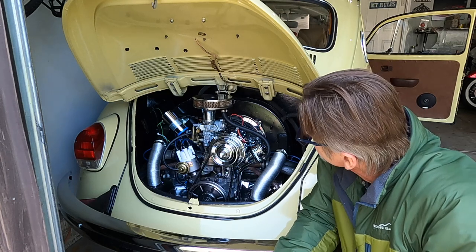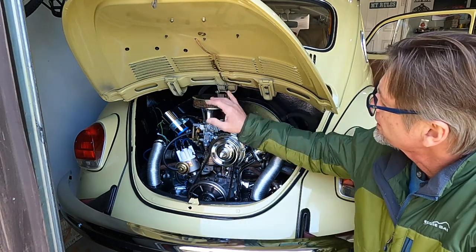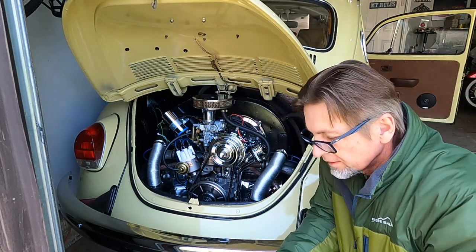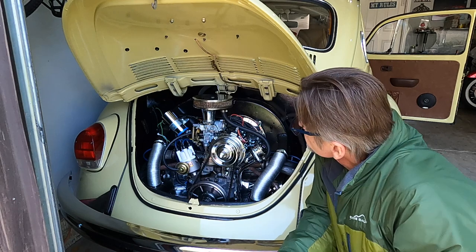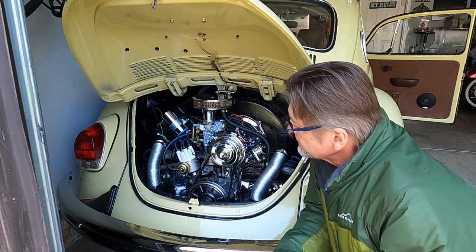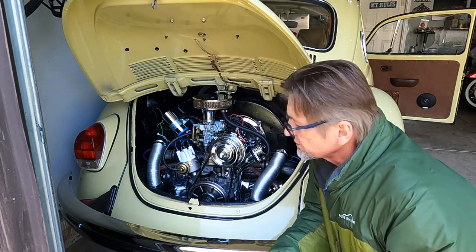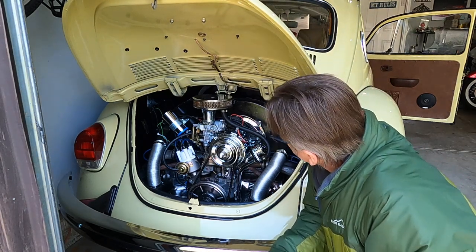I got that carburetor aftermarket cover on that to assure that nothing would go in there. The original oil bath, the hose that connects in the bottom like this, the little nipple just broke loose of the spot welds. I could have welded it back, but then I tried something different. I went and got some JB Weld super glue, super weld for steel, and I'm giving that a try to see if that works. If it doesn't work, then I'll just go ahead and spot weld it with my flux core welder. But I'll give it a try.